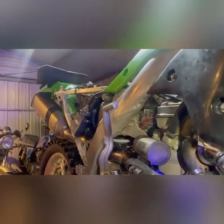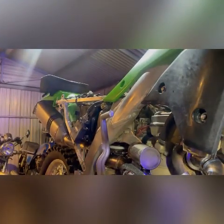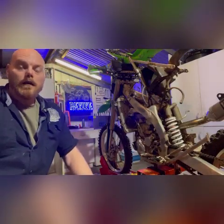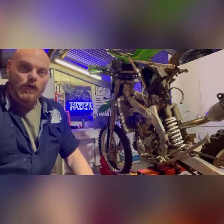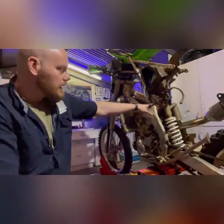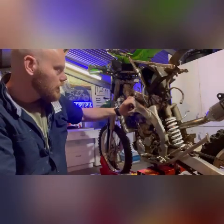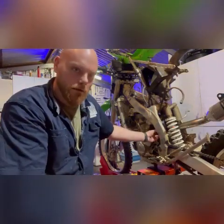I'm contemplating just pulling the whole carburetor out to give it an ultrasonic clean, which is why you see the subframe being disassembled here. But I'll try and give this a crack and take a picture. Well, that escalated quickly. Turns out there's no real good way to get the carb out without undoing the subframe. And I found, rather than trying to pull it backwards away, actually just leave this pin in and the whole thing swivels up while the wiring stays together. Probably looks like a mess to you right now, but honestly, carb is now loose, ready to come out.